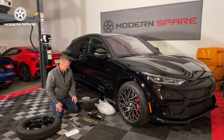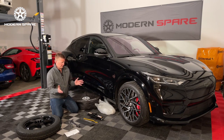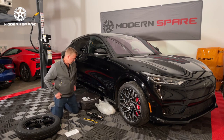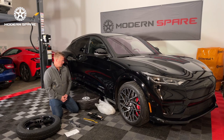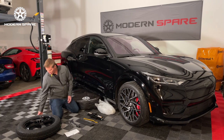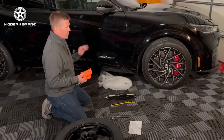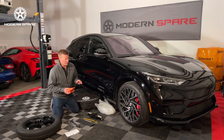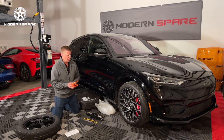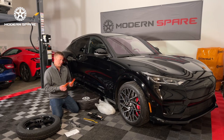There's also the bag and the jack. The bag is included so you can put your full-size flat tire in it, and then place it in the interior of your vehicle so it doesn't get the interior dirty. We do strongly recommend getting the vehicle in park on a flat, level, stable surface with the parking brake engaged. We also sell an optional set of wheel chocks as an added safety measure to make sure the vehicle doesn't rock around when you are jacking it up. Common wisdom is to put these on the opposite tire of what you are changing — today we're changing the front passenger wheel, so we are going to put these on the back driver's wheel.